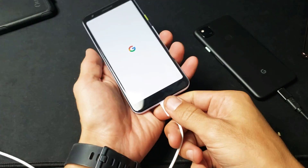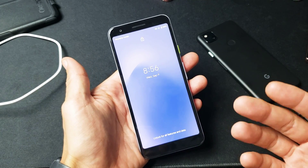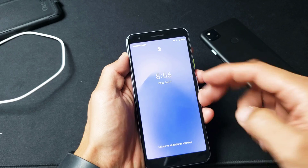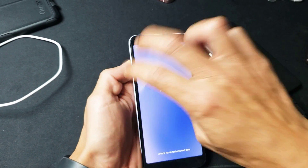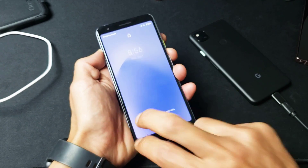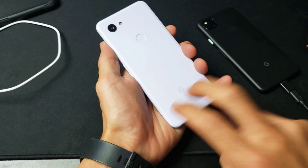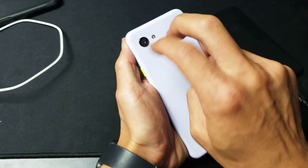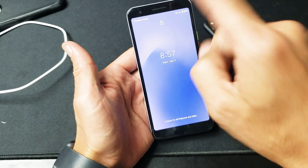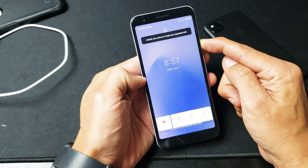If you're still not up, unplug the cable and move to the next step — what I call the tap method. Tap all over the screen and all over the back while your phone is on. Sometimes when you start doing this, the reboot will stop and you'll be able to log in. Use two fingers, tap kind of hard, and watch the screen. Turn it over and do the same near the lens and on top of the phone. Then press and hold the power button until the Google logo appears.